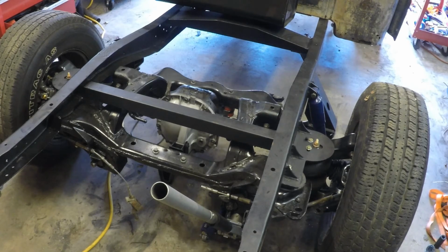I only thought about it after I turned these in to get them machined. You know, my concern was layout. It was getting everything symmetrical without proper equipment. It's easy to do if you've got the proper equipment. But now I think about it, thought about it later, and thought, man, I could have bolted those adapter plates on, centered all my holes, drilled them on a drill press. Took a little time, burned through some bits, used up a ton of cutting oil, but we certainly would have got it done. We could have turned right around and done the same thing on the rotors. So, I have regrets.